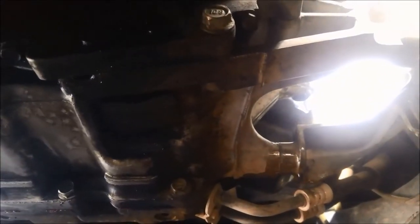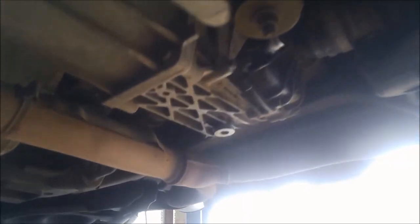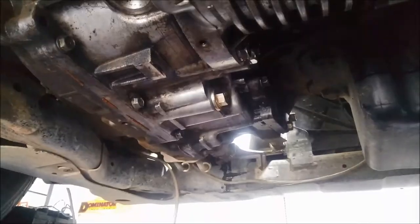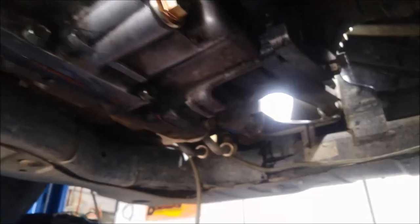Very awkward, and very easy to overfill. While you've got it up, good idea to check your rear diff, check your tail shaft, check your unis, check the centre bearing — make sure the rubber's not perished or cracked or split. And also the little boot on the front CV on that tail shaft. Just a matter of cleaning up that oil that I've overfilled there — or spilt.